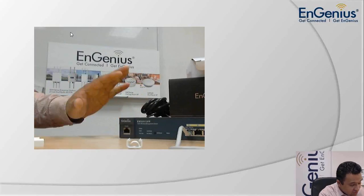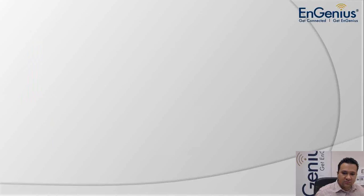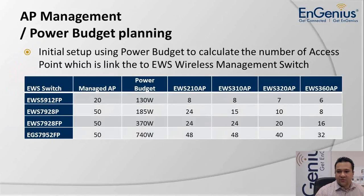Because, for instance, if you want to use this switch, if I go back to a few slides earlier, let me see if I can do that. For instance, if you want to use the 5912FP switch and you have the 360, you can only power up 6 access points. So you do not have enough power to supply the PoE power for 8. So in case you want to connect 8, then you need to have extra power. So you still don't need to buy an extra switch because you still have the power supply in your box. Okay, so far for this.